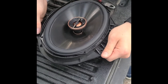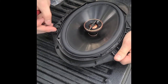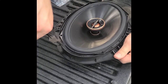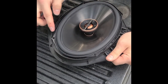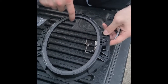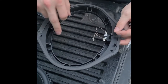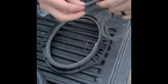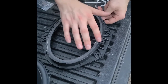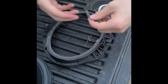Depending on your six by nine speaker, mounting may differ. We need to cut this lip out so the new speaker can sit flush in the bracket - give it a little nip where it starts and ends, go all the way around, then cut that section out. Once it's smooth all the way around, we'll put the foam that came with the speaker around where the old one was to keep a good seal. It's not necessary but it will help prevent air from escaping around the speaker.